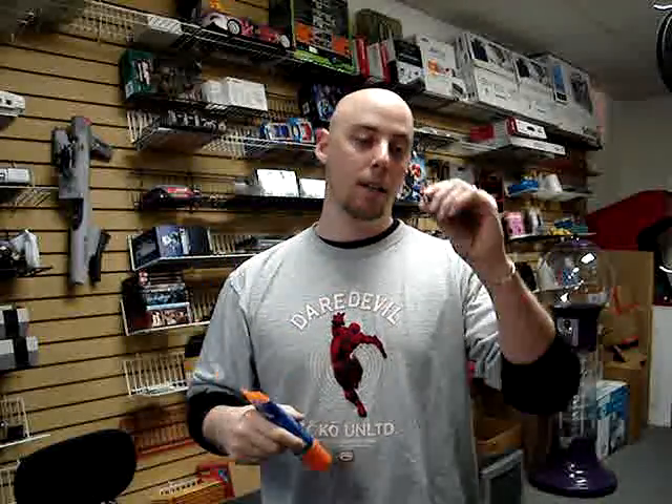When you've seen some of my mods like the Atari mod, where I actually ground down the old slots where the switches came out and filled them and sanded them — what I used to do that is just wood filler. You take it apart, sand it down, and in this case I had to grind the lip off those little slots. I taped it off in the back — since the slots were deep I didn't want to fill it entirely with wood filler because if you do it too thick it'll crack. So I hot glued inside, and once it was dry I peeled the tape off the back and did a small coat of wood filler on top. I then sanded it down with a rougher sandpaper, went over it with the finer sandpaper until it was nice and smooth, then primered it, painted it, and so on.